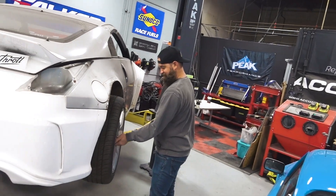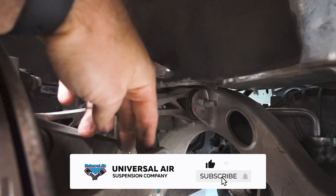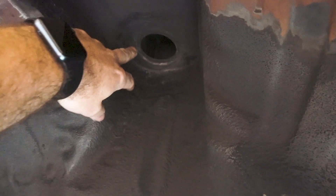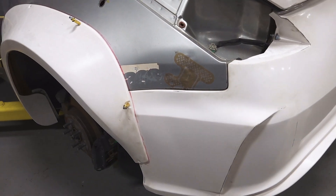Here with Mickey from Throttle to work on their 350Z project. We're going to help them develop a set of struts for the Tesla swap conversion. What we're going to make is a lower shock that goes into the bottom fork on the spindle, and then up top we're going to make an adapter to go to the upper factory shock mount, putting the strut unit in between there.